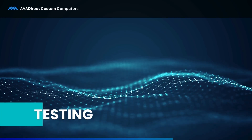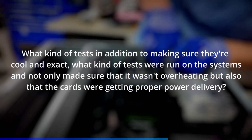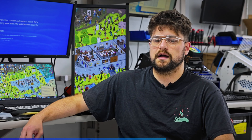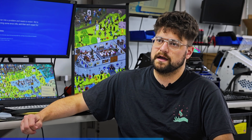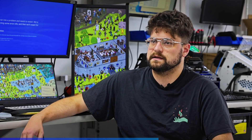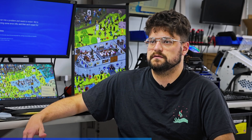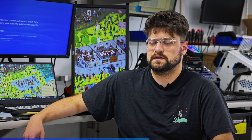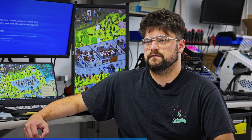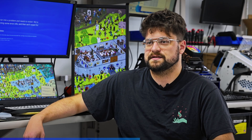What kind of tests were run to make sure the system wasn't overheating and the cards were getting proper power? We have a well-rounded and developed test suite that we've been using and updating over the years. We utilize a program called OCCT with custom parameters to stress the components appropriately. Most importantly for a system like this, you need a full system stress test — and that was one we focused on very heavily. We actually had to make a few revisions as we went because we weren't happy with it: still too hot, still too hot, still too hot. That involved some rearrangement — namely upgrading that rear exhaust fan because the normal one just wasn't keeping up.